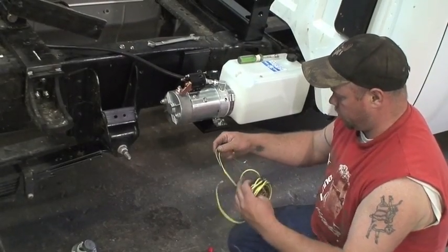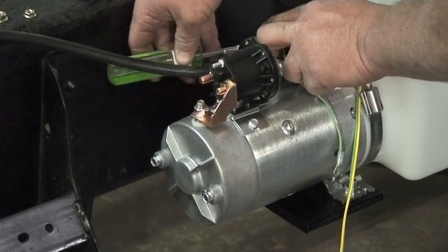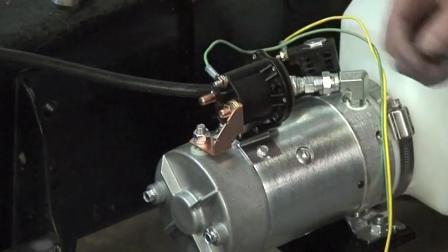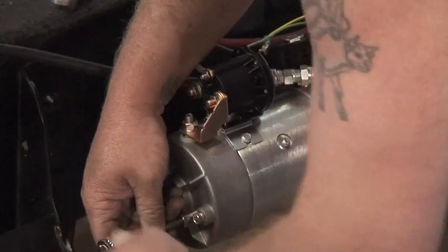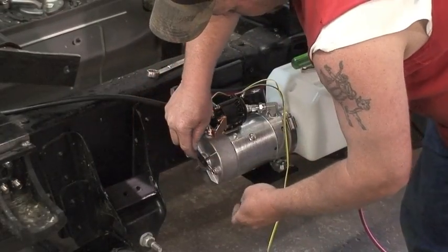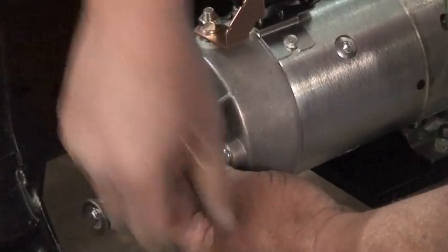It requires three wires to control this pump. In this application, the yellow wire goes to the coil, which makes the down function operate. The green wire connects to the small post on the black motor solenoid. The red positive cable goes to the power supply post on the black motor solenoid — the post closest to the truck frame. The big black cable, a number four welding lead, needs to have the end crimped on and be installed to the ground post on the back of the motor.